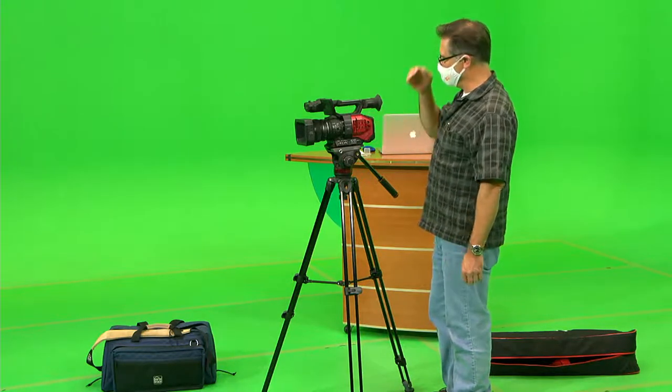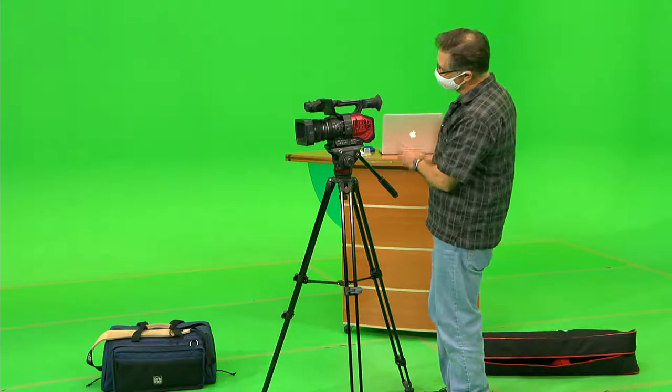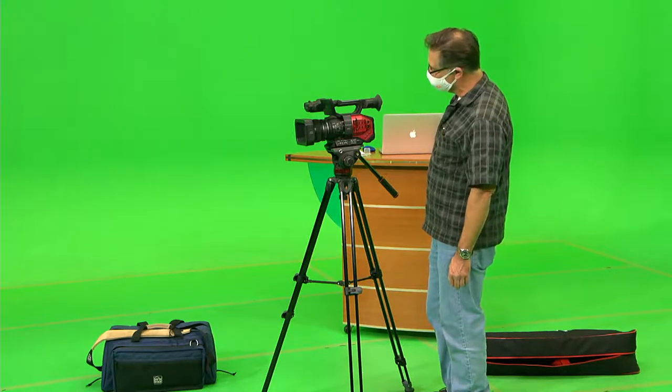Now we're in the red area of the camera. The three little buttons are user buttons 5, 6, and 7. OIS. The little icon in the LCD is a little wavy hand in the upper right below the battery. It defaults as on. If you push the button, it's going to turn it off, and you'll have a line through it. OIS is Optical Image Stabilizer.